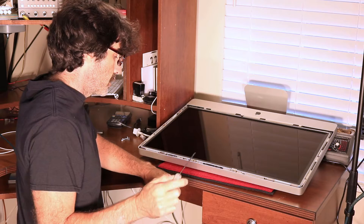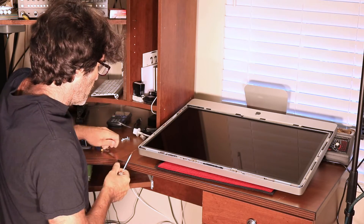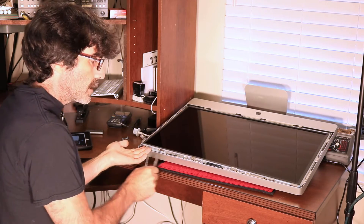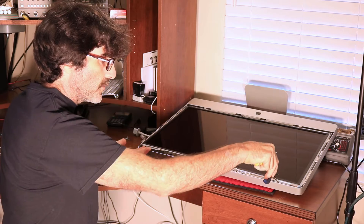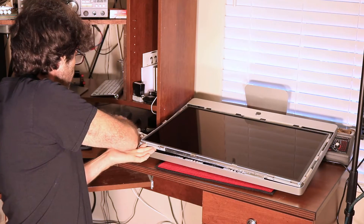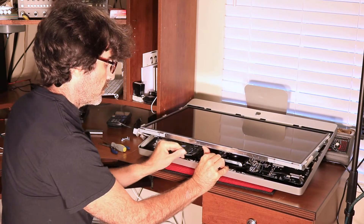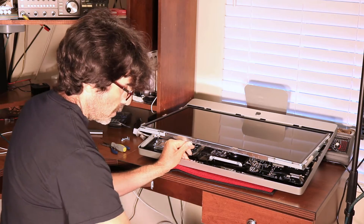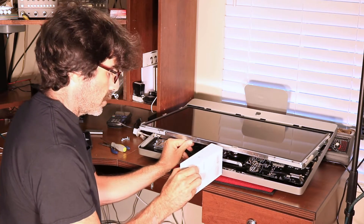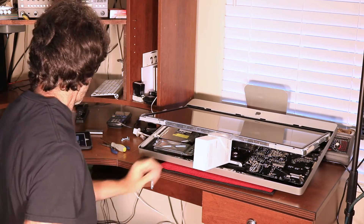I got the eight screws out. Let's carefully lift up on each side of the screen — a flathead screwdriver would work best. I'm using pliers, going against my own advice. Whatever something thin you can jam in there will be fine. Now what I like to do, since I'm usually working by myself, is shove something in here to prop it. Be careful — don't put something too big in there or you'll stretch the wires.